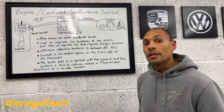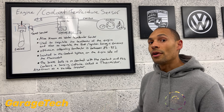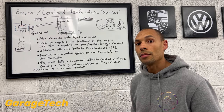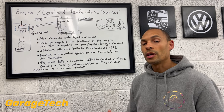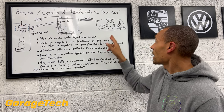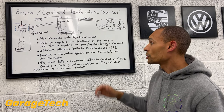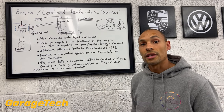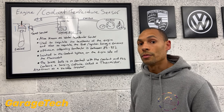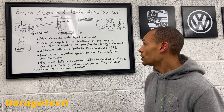The optimal operating temperature for the engine is around 85 to 95 degrees C, because that is the best temperature for fuel-to-air combustion. That will be displayed on your dash, and if the engine starts to get too hot you'll get a warning on your dash telling you the engine temperature is too high. So that's what this sensor is actually doing.